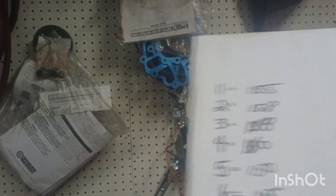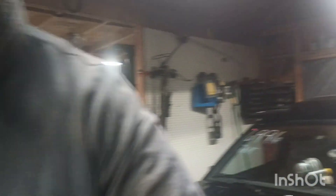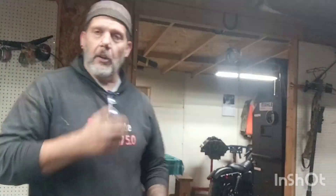It may sound a little bit low to a lot of people, but for a nine-to-one engine with a pretty good size cam in it, those numbers make sense. It's got a 110 lobe separation and it's got 238 and 248 degrees of intake and exhaust duration. So I think 150 to 158 cranking PSI is not bad at all for a junkyard motor.